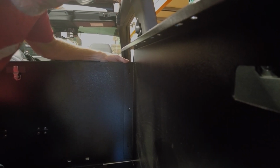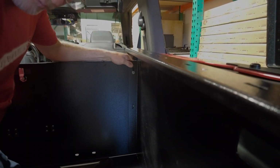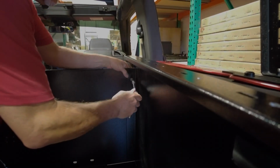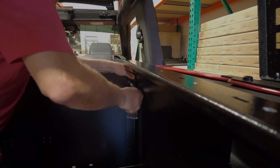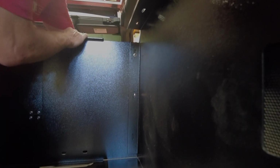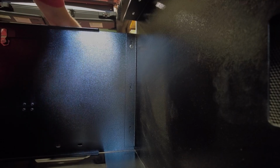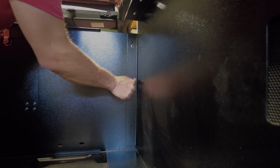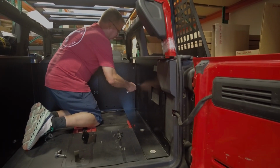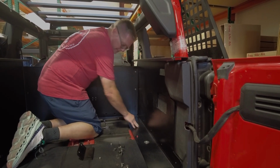Carriage bolt. And I'm going to put this in. And I'm going to go to about 90% tight. I want to still be able to move it, this way, left and right, once we get everything in and squared up. And then I'm going to do the same thing with the middle bolt. Feel it just before it gets snug, so it's still loose, so you can move everything around. Because we want to make sure all the holes line up as we're putting everything together.